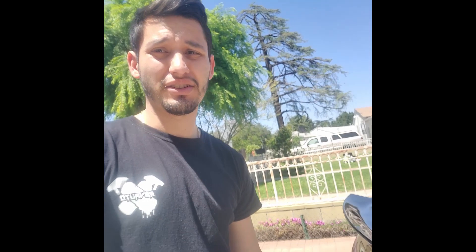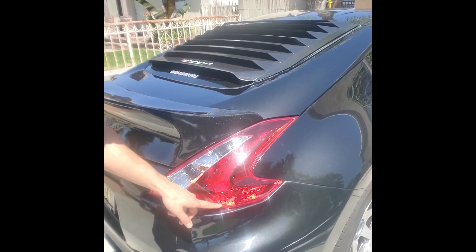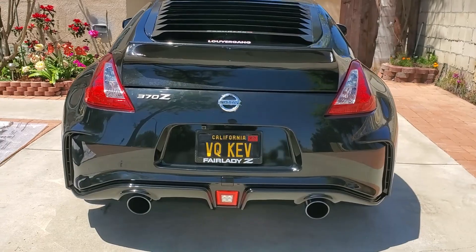So I want to apologize because the video corrupted, but the last part I left you guys off on was taking off the rear fog light. From there it's just two clips holding the bumper and then you can literally just pull the bumper straight off. You put the new one right back on, put the new fender liners on, and then you're pretty much done with the rear.